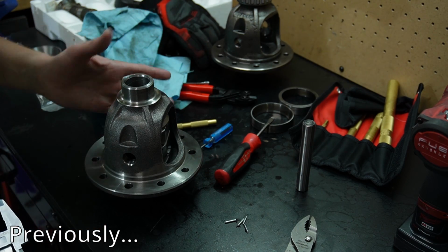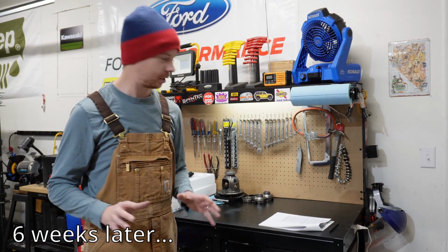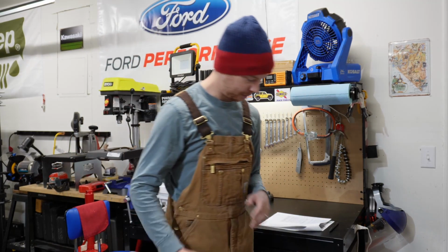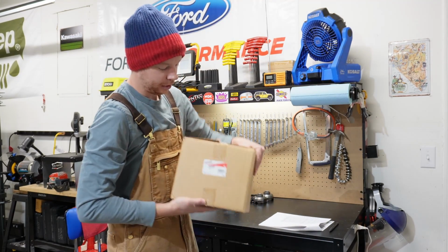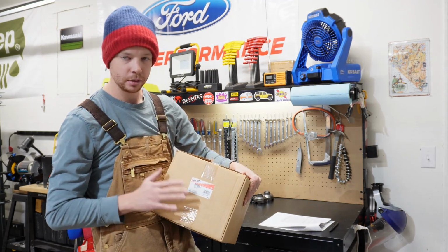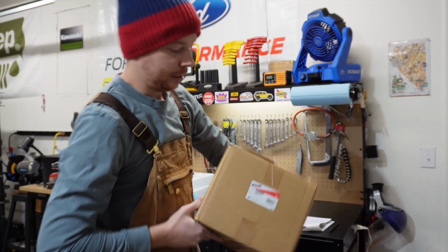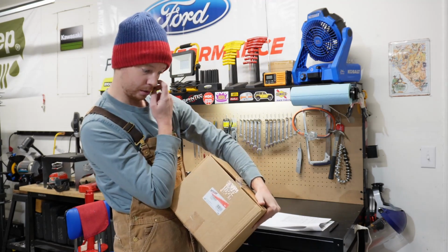It's like 10,000ths too small. Okay, I think it's finally time to actually do the regear for real on the Dana 30. I have a new carrier. This time it is an actual Spicer part. It's not a Yukon part, so hopefully this works. I'll put a link in the description for this one. And I would say get this one, not the Yukon one, if you're actually doing your own gears.